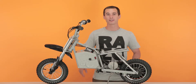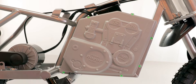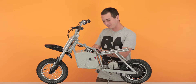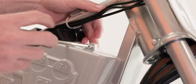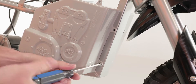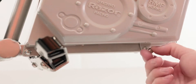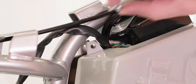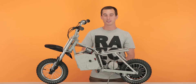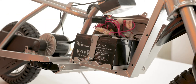Next, we'll be removing our battery cover fairing. To do this, there are six Phillips head screws that need to be removed. Take your Phillips head screwdriver and start removing those. These screws are secured together by a nut on the backside of the plastic — pay attention as they may fall out and get lost. Once you have all six screws removed, simply slide the back battery cover straight out and set it aside.